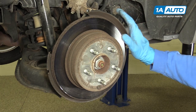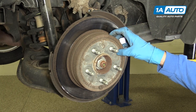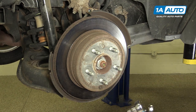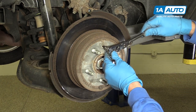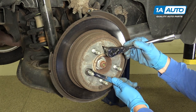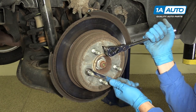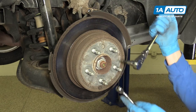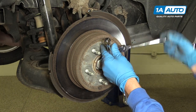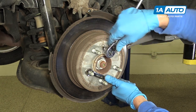Now we want to take off the rotor. One thing worth noting is that you don't want your parking brake to be on if you're trying to remove the rotor, because the parking brake is going to hold the rotor onto the car. So first, make sure your parking brake is off. Second, we're going to take a T30 Torx bit on a three-eighths ratchet — it looks like a star. Now a lot of the time these things are really tight, so what I like to do is take a wrench to hold the rotor in place while I loosen the bolt. Sometimes it's better if you have a friend doing this. The bolt is actually coming loose really easily in this case, but a lot of the times these things are stuck really tight. So normally what would happen is you turn this and the rotor will turn with it and you won't be able to loosen it. Having a wrench like this to hold the rotor still is a trick to get around that.